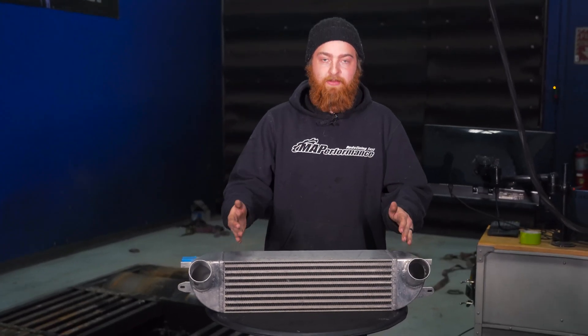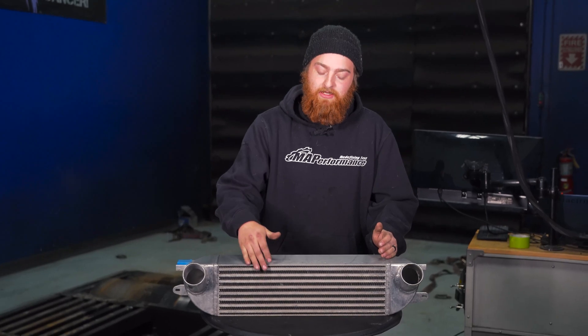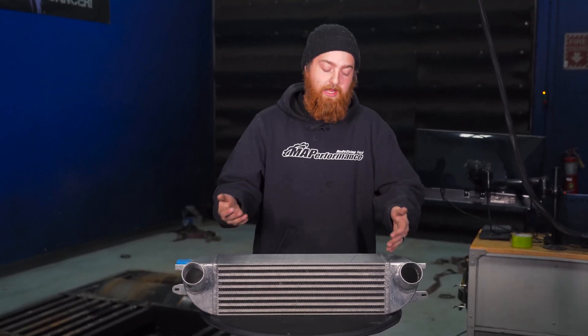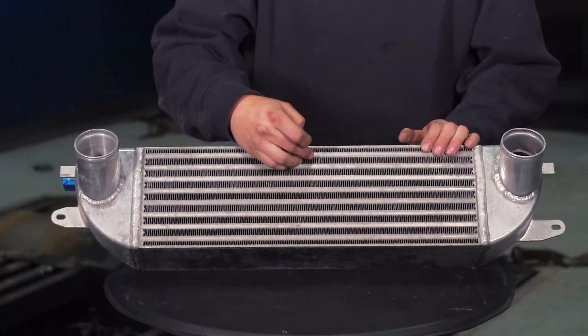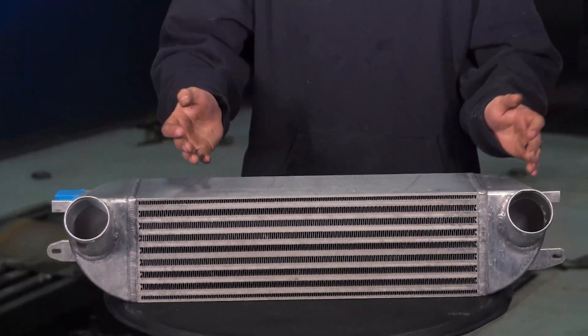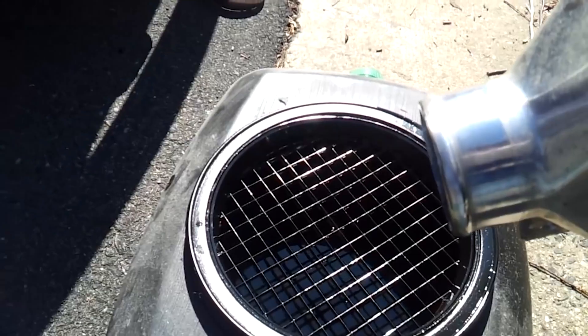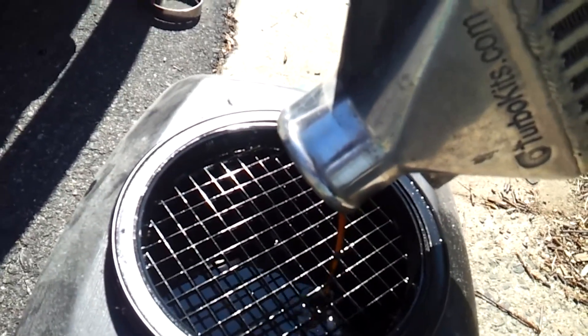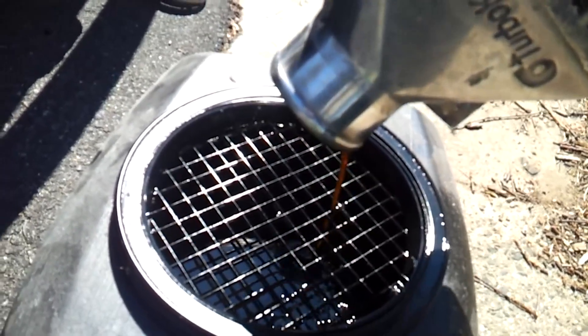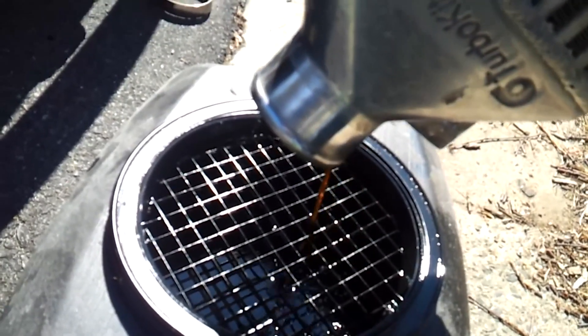For those of you balling on a budget and looking for pre-owned intercoolers — when you're looking at a pre-owned intercooler, one of the biggest things most people obviously look for is bent fins. Some of the not-as-known things to look out for are pinched or bent tubes or bent bars, because you can have a leak there and those can be hard to pinpoint. Another thing to look out for is oil within the intercooler. If there's oil in the intercooler, it's going to affect exactly how it cools — the ambient air passing through isn't going to be able to pull out the heat as easily, and you could also have some resistance inside resulting in more pressure loss.